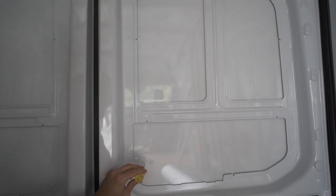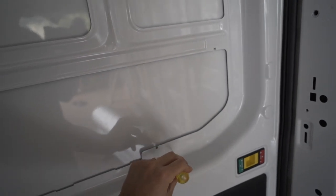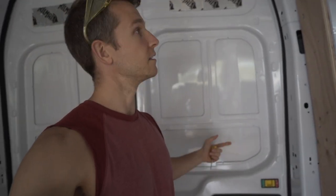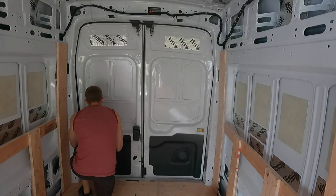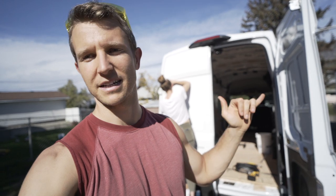I'm going to start using the awl to trace out the rear cargo door windows. The thing that's a little tricky is there are actually two lines you can follow. At the bottom is our outer edge that we want, but then it juts up. What I found online is the best thing is to use the awl along this edge, then measure three quarters of an inch down — that will match up with the original line and result in a nice big open window. It's particularly important when you put the trim on, because you don't want the trim to have a big jut in it. It'll be more of an oval shape. It's the same process as the sliding door — basically just two of them at the same time.